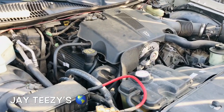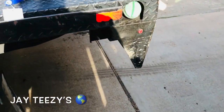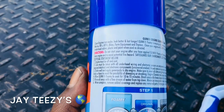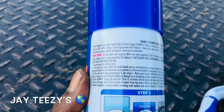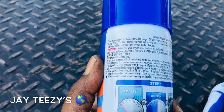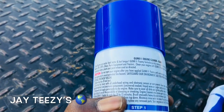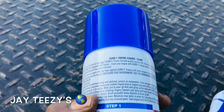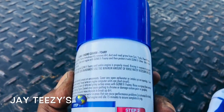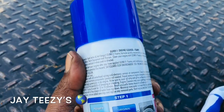Try to agitate and get some of that filth out. Let me read the instructions to you. Engine must be off and cool. Allow Gunk to soak for 15 minutes - take the longer soak to break up dirt. Start engine and idle 15 minutes assuming complete drying.